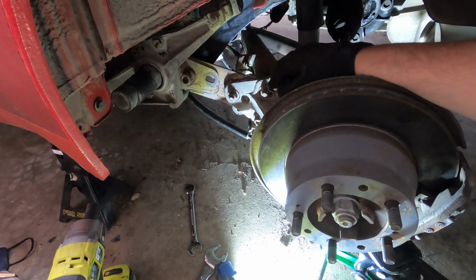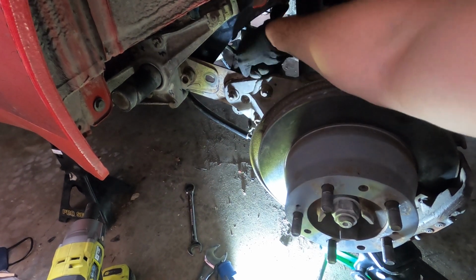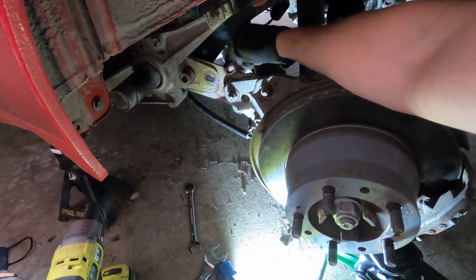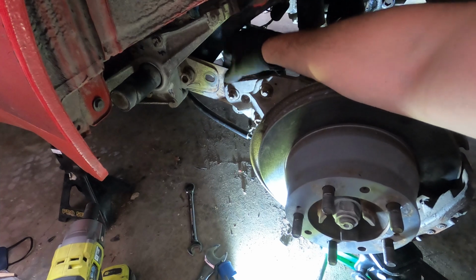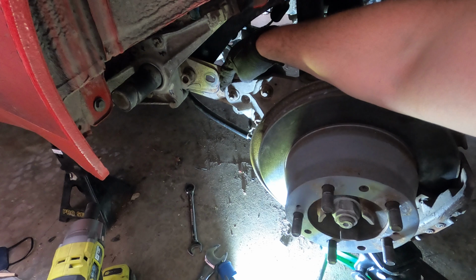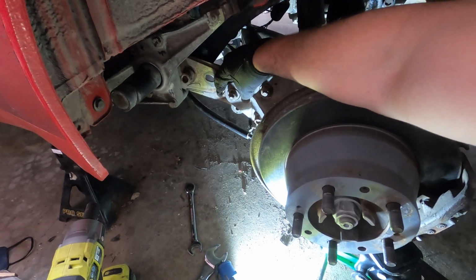All right, so you can see here the bolts I was talking about. Here's the center bolt, and on the other side of this, that's where the sway bar mounts to. On the back of this, there's a 27mm head in kind of an oblong shape that sits in a hole back there a little bit, and it adjusts where the front of this rides, forward and backwards. That's going to control the height at where this is sitting.